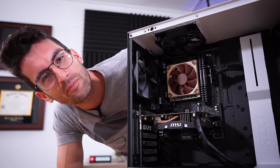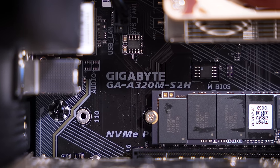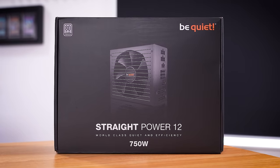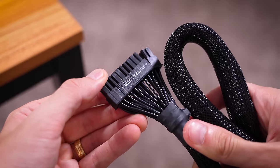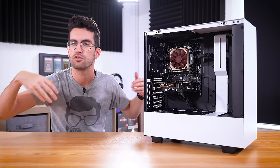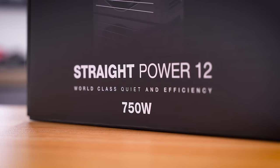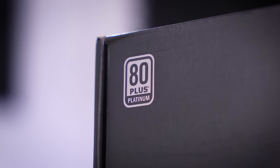We have practically rebuilt a PC from the ground up. I reused the A320 board from our test bench — it's not a high-end board by any means, but it's actually the only board I currently have that still supports the 2400G, and it's still better than the HP-specific one we were using before. I even threw on a Noctua low-profile cooler. I also stuffed in a very premium BeQuiet Straight Power 12 750W power supply — an 80 plus platinum unit, definitely overkill for this combination of hardware. With CPU and GPU, we're looking at maybe 250–300W under full load, and we've got more than double that here. The point was to give this viewer something they could very easily rehash and relocate into a newer build down the line. 750W should be plenty for any reasonable combination of hardware, and it's fully modular, runs extremely quiet, has great efficiency, and comes with an epic warranty through BeQuiet.